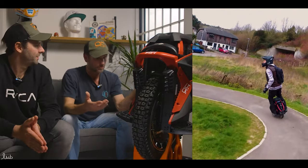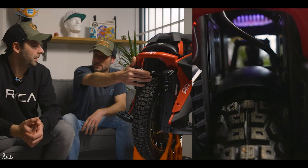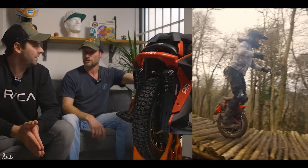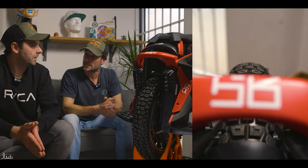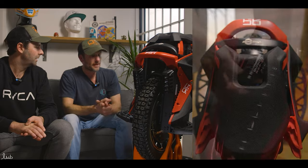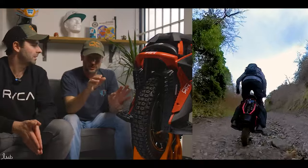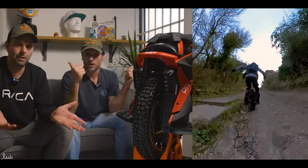The 130mm refers to the travel from the chassis to the wheel — not the actual shock absorber stroke. You can get the shock dimensions if you want to upgrade. What you need on travel suspension — if you've got 130mm, that's plenty. The shock is rebound adjustable, has preload, and it's coil sprung. You set the sag via the actual coil spring — there's a castle nut on top that you rotate to set your sag height, separately from rebound and damping. You zero those dials out, set your sag first — on average about 15% of the travel — and every rider has a different sag height but it's always relatively the same distance on the shock. It's adjustable on the S20.